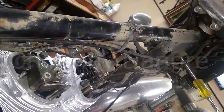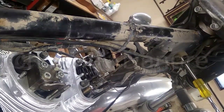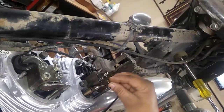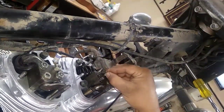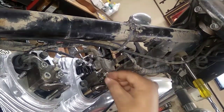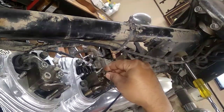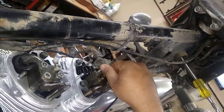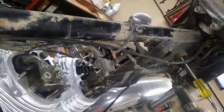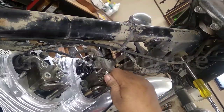When you are tightening, you have to do sequential tightening of the nuts — do not tighten in a line. The tightening sequence is important. There will be one washer and one nut for each stud. The threads are common — there is no thread sequence — but the tightening sequence is very much important. You'll have to use inch spanners here; you can't use mm.